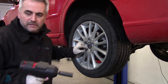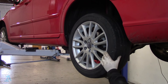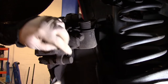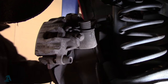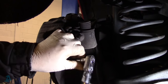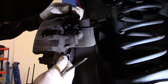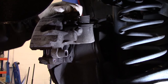Leave one wheel nut on because the wheel's going to be stuck — just smash it off. There we go. Next you've got to release your brake springs from here — stick a screwdriver under there and lever that out, the other one will pop out as well. Next, pop these little rubber caps off the ends. In there you've got a 7mm Allen key. Take these sliders out and it should wriggle free.